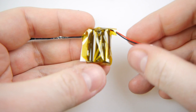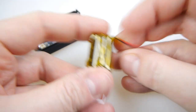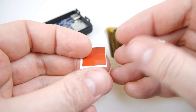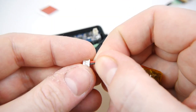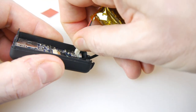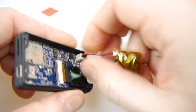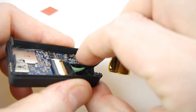Now we're just going to put the capacitor in. The idea of the capacitor is that instead of a battery being charged over and over again, the capacitor works like a very short-term battery — it just keeps the camera running. It's got a little sticky-back mount on it. This end has a plug which only goes in one way around — you can't get this wrong. All these things are very simple, so anybody can do them, but you do risk damaging things every time you mess around with something like this, so just be a little bit careful.